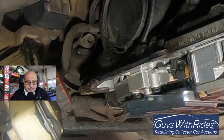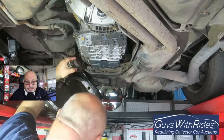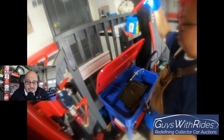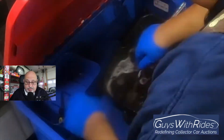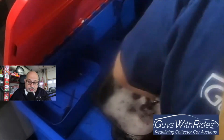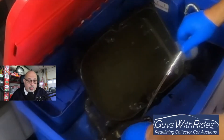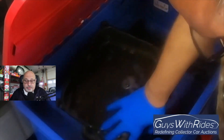The pan was hanging and I had to take care of an air tube that connects to the reservoir, so I used some pliers and a screwdriver to get that rubber hose off. Once I had the pan off, I was quite pleased to see how clean it was inside, but I went through and used my parts washer to clean it out. There was no magnet inside and I did not find any metal shavings — very surprising given how clean this fluid was.